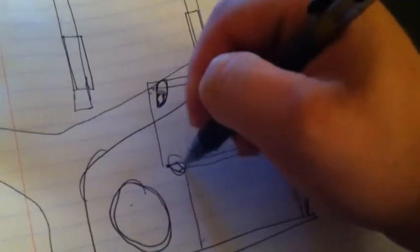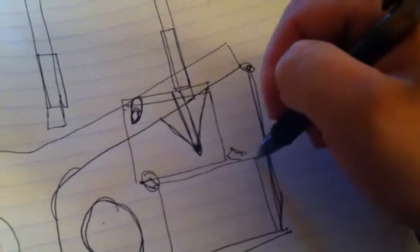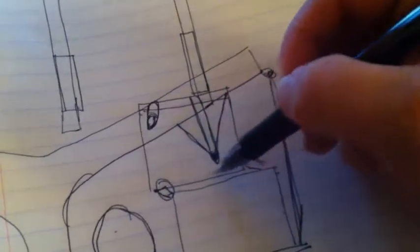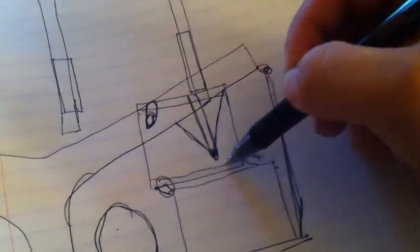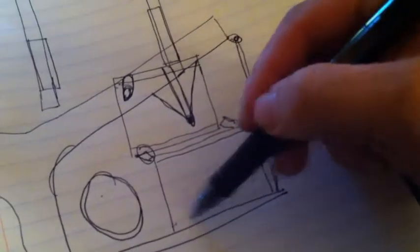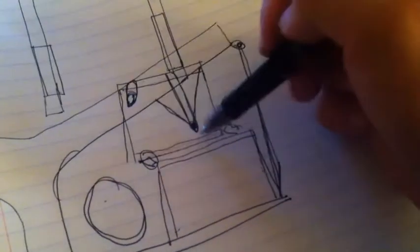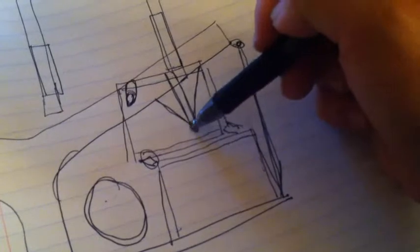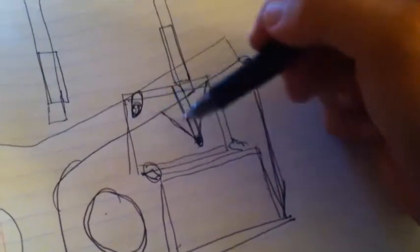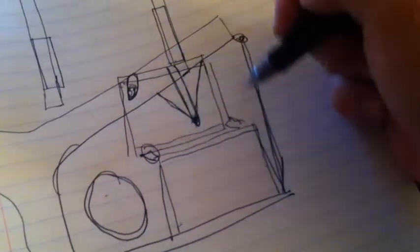So all you have to worry about, really, make sure you get those gussets welded in there. Those are really important. Without that, the trays won't stay together. Get the little tubes welded on to put the threaded rods through, because those clamp the upper tray to the lower tray. And with this lower tray, on the lower pack and the upper pack being one piece, it concentrates all the weight through the threaded rails, through this tray, middle tray, up to the upper tray, and then from the upper tray into these mounting points. So it's really important that you get good welds on those gussets and on the tubes.